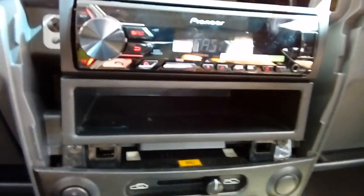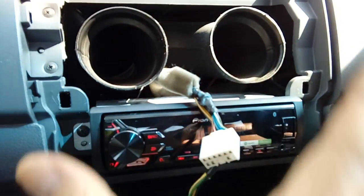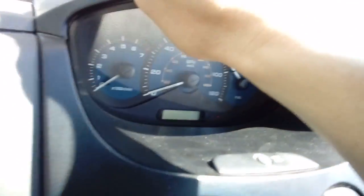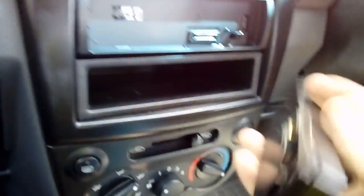Now you're left with putting your dashboard back in — very straightforward, it's just the reverse of taking it out. Don't forget to clip both switches back in: your hazard warning light switch and your trip computer reset switch. Then we'll push it all forwards and clip it back in. Get hold of your dashboard, watch your stalk controller right near it, make sure your wire doesn't trap behind it where the heater vent is — move that out of the way — and then simply but firmly tap it all home again. Make sure they're all lined up — you don't want to break any clips. All the way around, nice and flush.